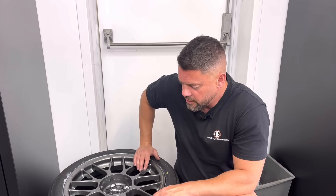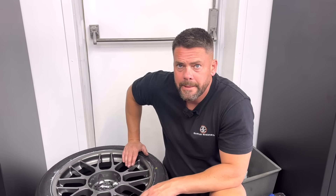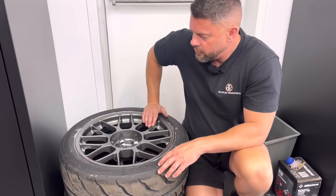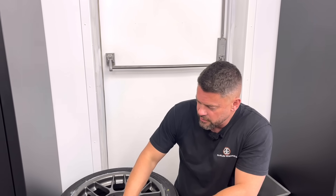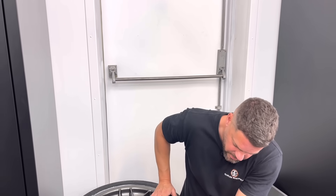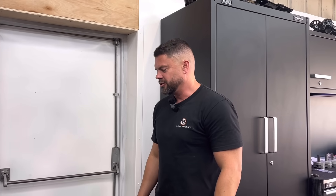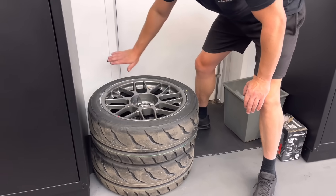On the back we've gone for 215/45/17 and that has given us exactly the look we want, because the Triple 8s are a bit more of a bulge on the edge of the tyre. We wanted it just a bit proud of the rim — we certainly didn't want them looking stretched. And we don't want something that's too wide on the front — you want a nice big bubbly sidewall to protect the rim, and it's going to look lovely. Hopefully where the tyre goes in at the top we'll have that just under the arch. What Nick has worked out is if we can get away with a nine and a half inch on the back with a 245 tyre — probably a 245/40 to keep the sidewall the same height — it will look almost identical to this on the wheel but an inch and a half wider. Nine and a half on the back will also have a bit more of a dish.